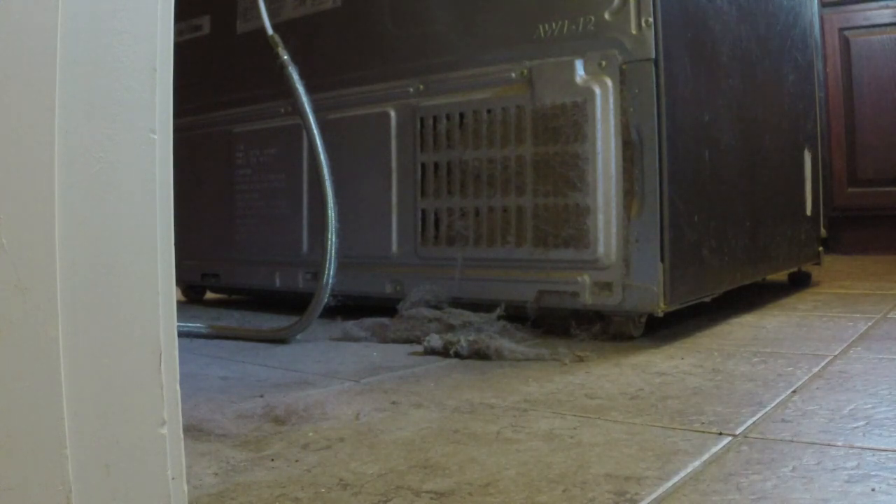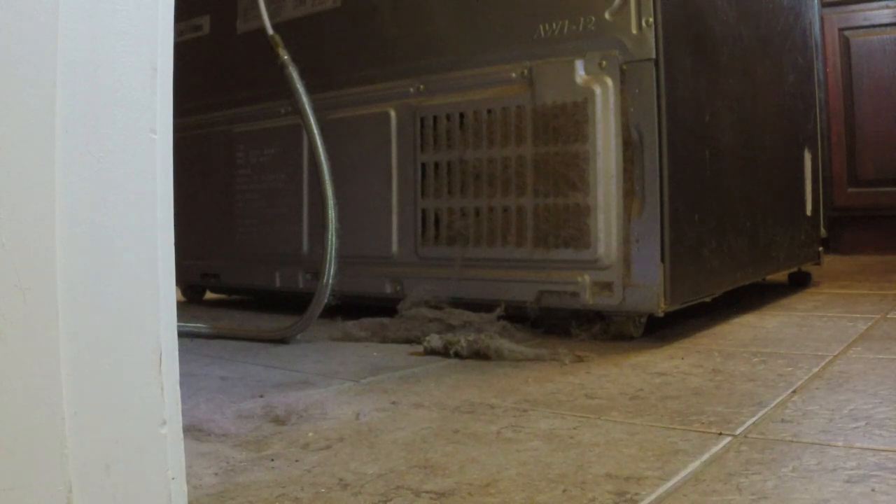So take a look at this now. I've moved my GoPro down there right behind there. You can see there's already a big wad of hair and dust that's rolled out from underneath the refrigerator. And you can see that louvered vent — I think because of the way it's all packed in there, it's sucking air from the back of the fridge and pushing it out the front. So I'm going to blow it the other way around — blow it from the front, try to push it out the back, and see what happens. This might get a little crazy.